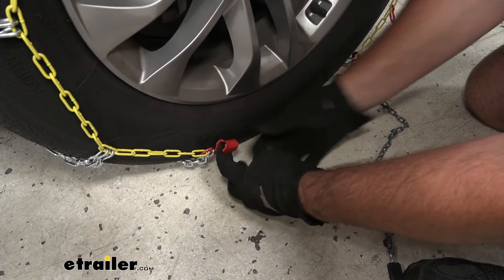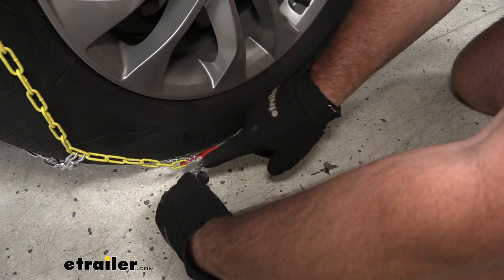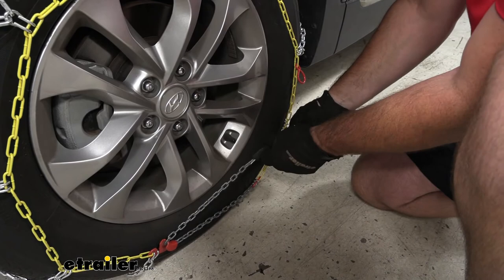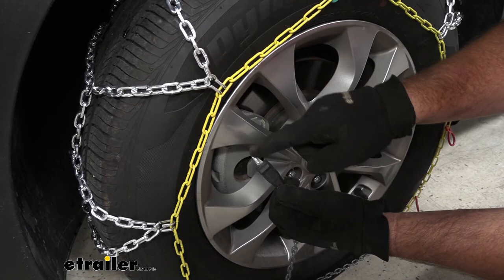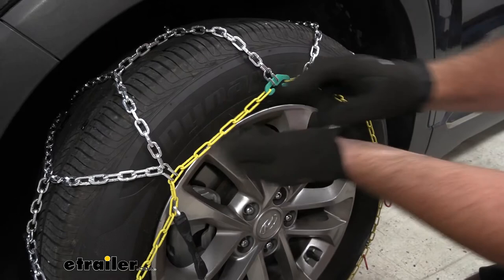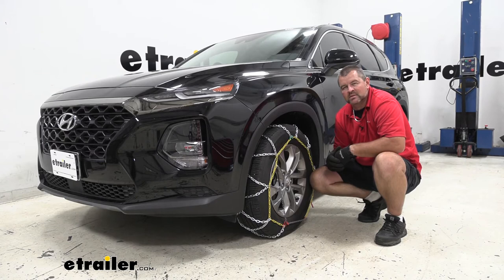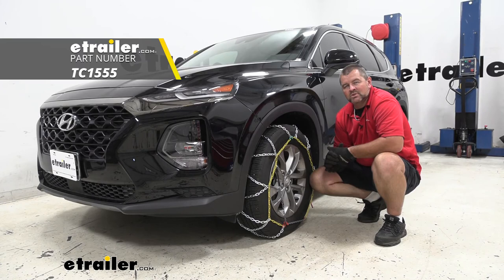We're going to have a red piece here — notice one side is open and one side is flat, and we want the flat side against the tire. Take the gray chain and feed it through the red bracket. You'll notice the notch there, which is what locks the chain in place once it's tight enough. Pull it as tight as we can to get it locked in, then hook it up — making sure the hook is facing out with flat sides towards the tire — and get it as tight as possible. Once one side is on and you've repeated the process on the other, drive forward a few feet and check the tension to make any adjustments necessary. And you're ready to go! That's going to do it for a look at and installation of the Titan Chain Alloy Snow Tire Chains on the 2019 Hyundai Santa Fe.